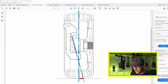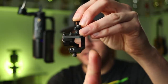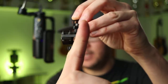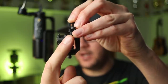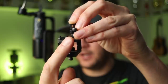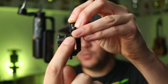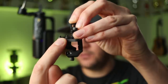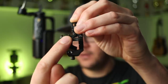Here you can see that the steering axis is actually inclined. At zero camber, the steering axis has some inclination to it. Now, on the other one, if I pushed here in line with the steering axis, the knuckle wouldn't turn. But now it's moved that point further out - even if I go out here and push, nothing happens. I have to go really far out on the knuckle for it to turn when I push on it.